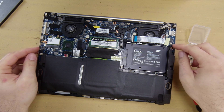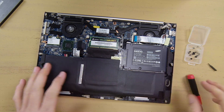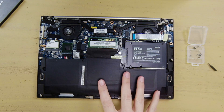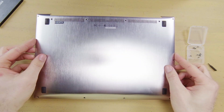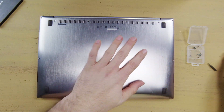Once you've got that done, make sure you didn't yank out either of the wires, and slide your battery back into place. Put all the screws back into the battery. Once you have all the screws taken care of on the battery and on the hard drive, you can return the cover of your ASUS ZenBook back to its rightful spot. Reattach all 12 of those screws and you should be good to go.